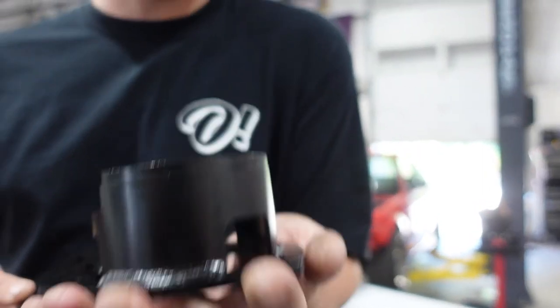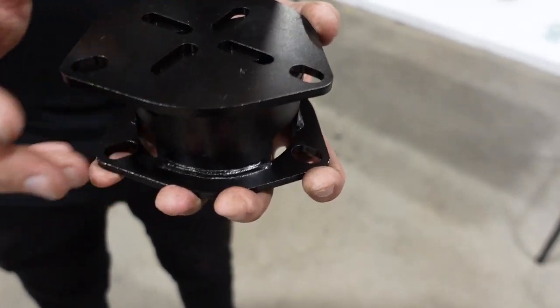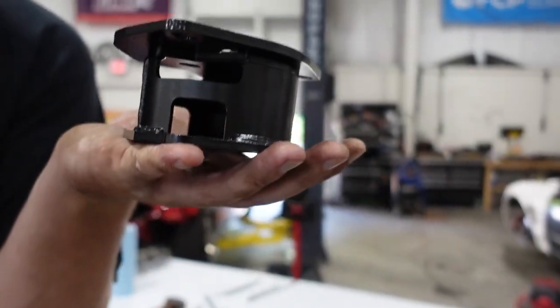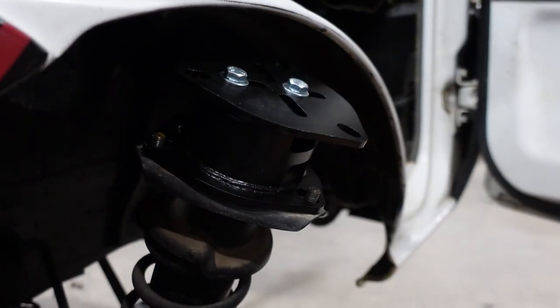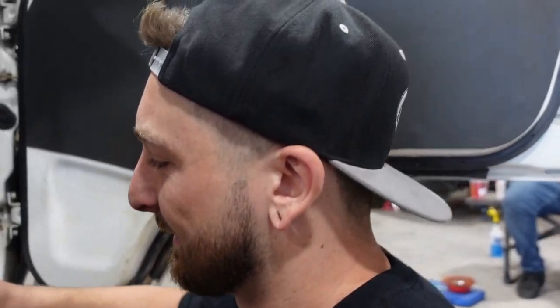All right, so this is what we need for the front to lift it about two inches. We have the base plate that bolts to the coil itself, and then we have this camber plate — because once you raise these things up they get crazy positive camber, since these little baby control arms are only meant for the existing height. We're going to allow max camber and basically use it as a giant spacer that bolts right on. This is my first time ever lifting anything in my life — and it's the last thing, I hate it.